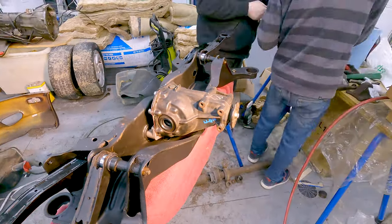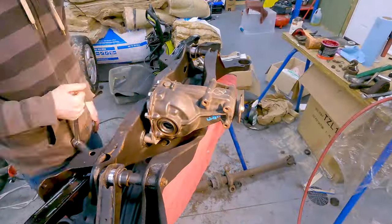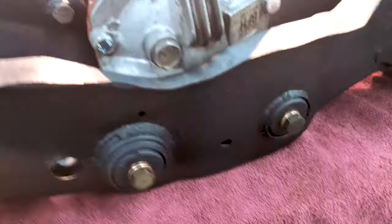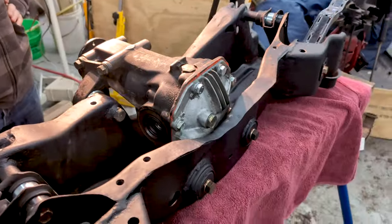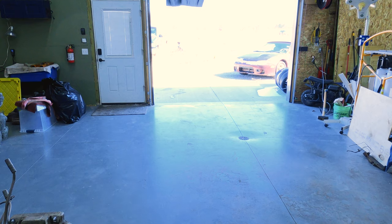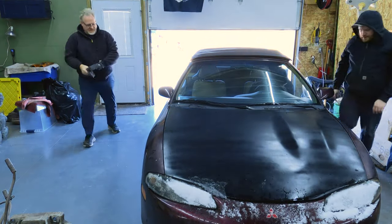The diff is in. This is as far as we're going to get with the rear subframe until we put it in the car. We've got the diff in and torqued with all three solid aluminum bushings, because Camden swears he's going to road race this thing and we don't want any flexing. While we wait for the subframe bushings to come in, we're going to focus on getting the old shell off the lift — which means taking the front-wheel drive subframe from the new shell and putting it on the rusty all-wheel drive shell so it can roll around.